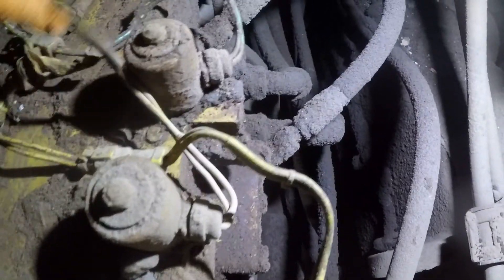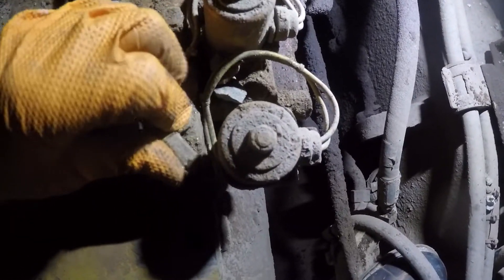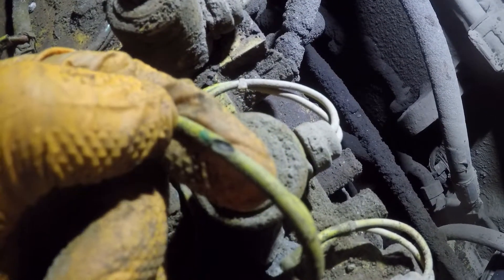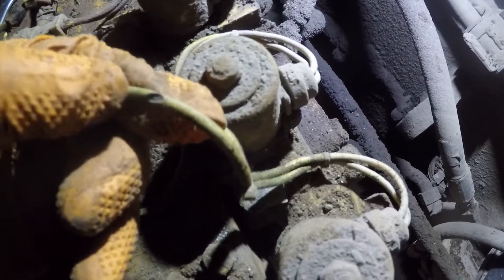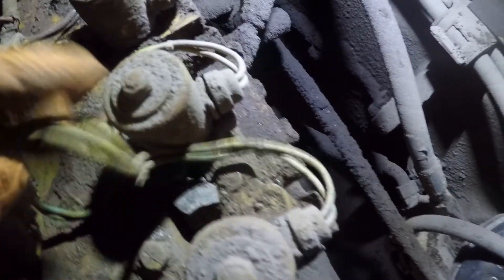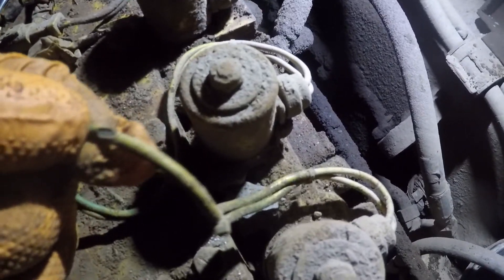Just doing a quick visual right now. This wire was also tucked all weird down in here, down around behind a bunch of rocks and stuff on it. Look at that right there — it's chafed all the way through; bare wire right there. Like I said, this one was tucked all down in here. Most likely this was shorted to the transmission, which would pull the voltage down to ground and cause this solenoid not to have any power to do its job. So let's repair that.